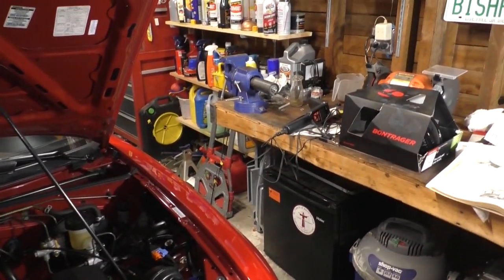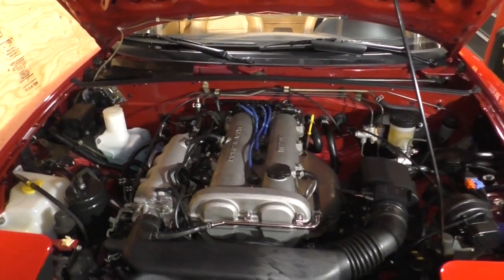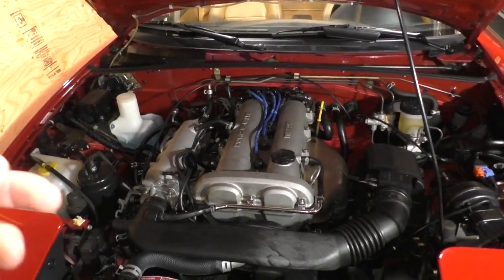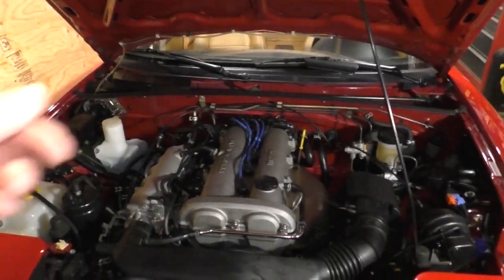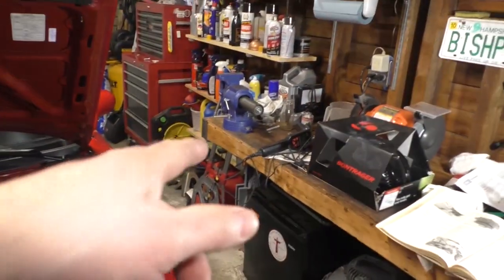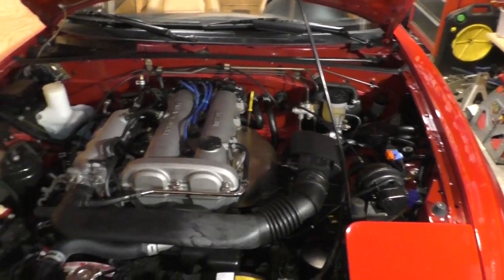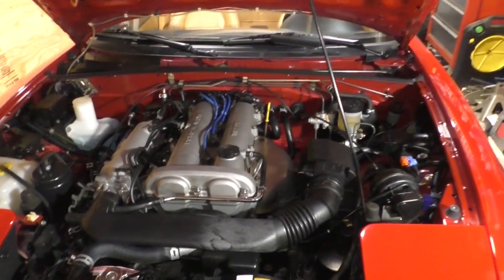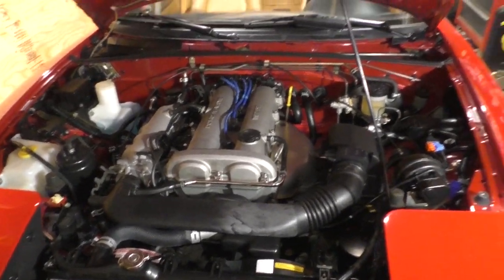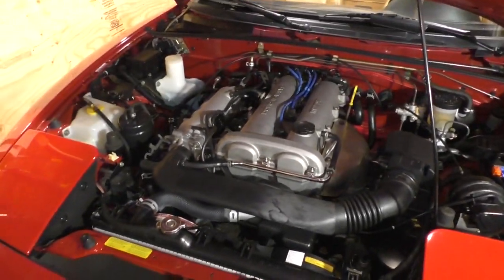It's going to show you the engine speed. Now, on this car, because of how the ignition system works, I believe it sparks either every revolution or every other revolution. So, wait. No, it sparks every revolution. So, bang, bang, bang. What you want to do is take whatever that panel reads. In this case, it was reading 2,000 RPM at 1,000 actual RPM. You just cut that number in half. Your target number is 800 to 850 RPM. I set mine to like 810 maybe.